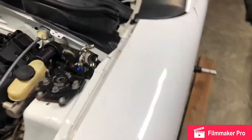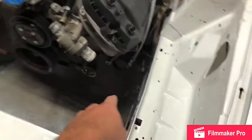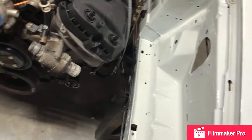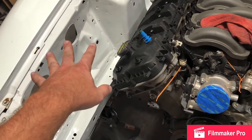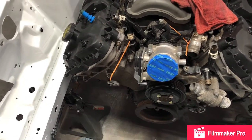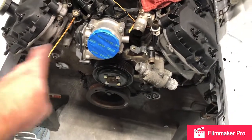I got a couple more fittings coming — I'm gonna do a 180 off of this, run them all through that wiring harness hole along the inside of the frame rail. There's gonna be one coming out here to the rack, one coming out of the rack, probably around over the pump. I'm gonna do the pump over here, reservoir probably here, and return line will probably come right across the K-member on the bottom across to the reservoir. I'm not sure — I've got it all mapped out.